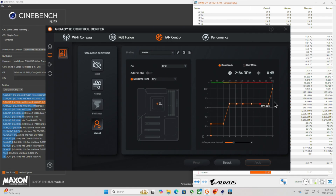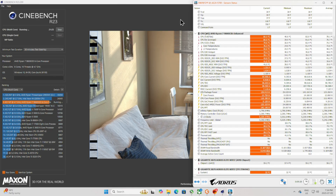Turning the fan speed down to 68% on the pro model brings the decibel level to around 44 to 45 dB, comparable to the non-pro model. Almost 10 minutes into the second 30-minute Cinebench R23 run with reduced fan speed, the pro model hit 82 degrees compared to 84.6 degrees on the non-pro at 44 dB — a 2.6-degree improvement. Even though 68% of 3000 RPM is roughly 2000 RPM (the same as the non-pro's max), the seven-blade design over five blades still delivers a 2.6-degree performance advantage.